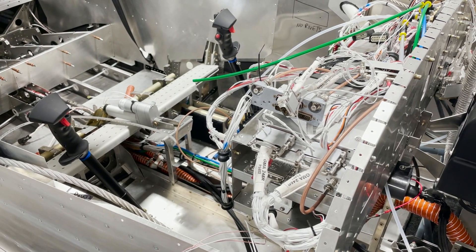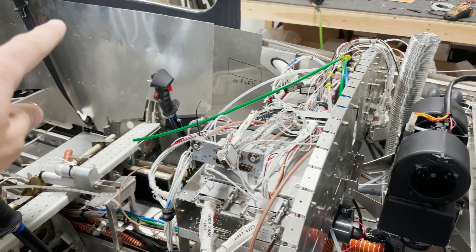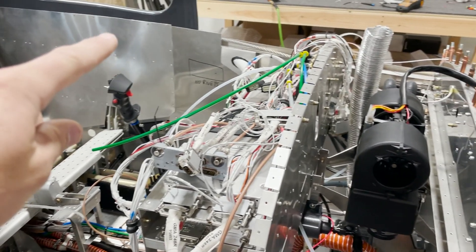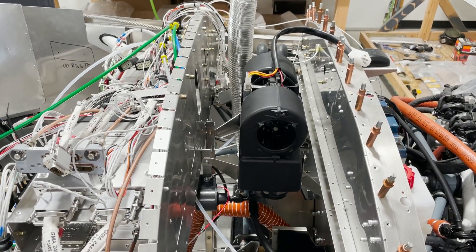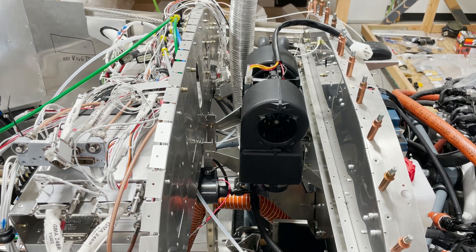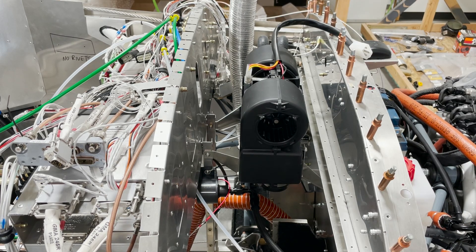For the back seats, just to make sure that the heat does get to the back seats — sometimes using the side channel down here gives too much opportunity for the outside cold air to cool that air before it gets back to the back seats. So that's what we're doing on this one. If you want to use the standard setup, that's just fine. Now we'll get all our ducts attached and move on to wiring.